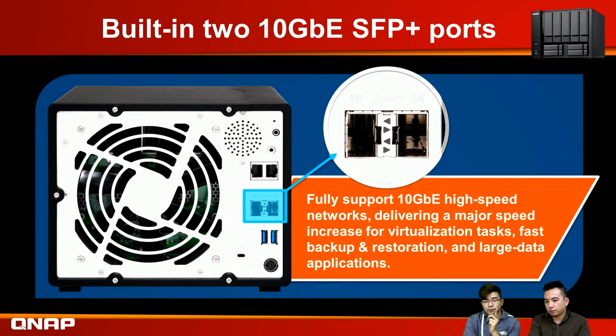So this one is really made for SMB, with 4 SSD slots for your auto tiering, and then at the rear panel, you can see that we have 2 built-in SFP+ ports for your faster transmission speed, and we still have 2 gigabit ports for you. So I think this one is good for being a mail server or department public storage space. Yes, that's right.